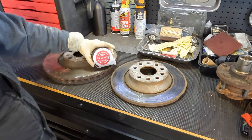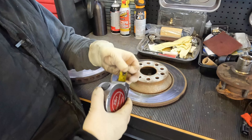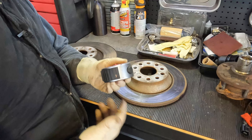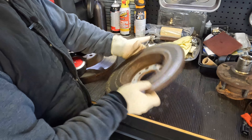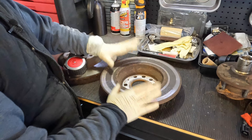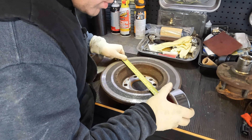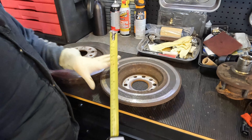All you're going to need is a tape measure. I use the Snap-on one — it gives you very detailed numbers, but realistically all you really need to know is the inches. I'm going to flip the rotor over. The reason is you have the top hub here, and you want to get a nice solid reading. So you always want to flip them to the side where it's easy, then go ahead and put your tape measure across.